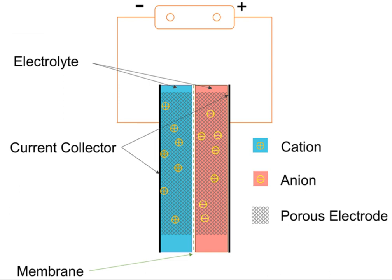The supercapacitors recaptured braking energy and delivered starting energy. Fuel consumption was reduced by 10 to 15% compared to conventional diesel vehicles. Other advantages included reduction of CO2 emissions, quiet and emissions-free engine starts, lower vibration and reduced maintenance costs. As of 2002 in Lausanne, Switzerland, an electric bus fleet called TOHYCO Rider was tested. The supercapacitors could be recharged via an inductive contactless high-speed power charger after every transportation cycle, within 3 to 4 minutes.